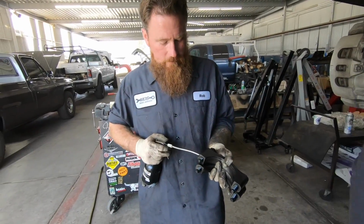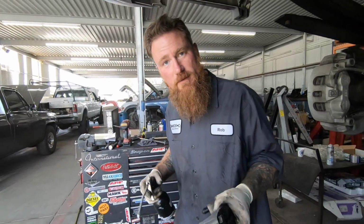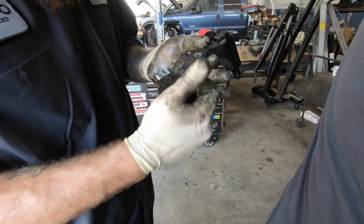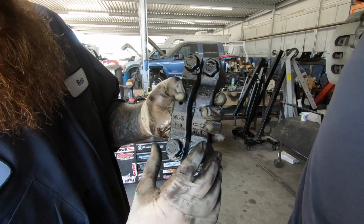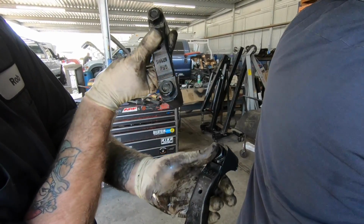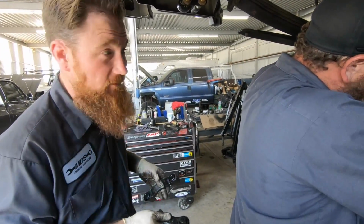On your cap bolts, you just want to oil the threads and oil the flange on the bolt. You don't want to use Loctite because it's going to affect your torque value and you won't get the correct torque. Wow, I had no idea. Also, that's good to know. Before you remove the caps, you need to mark them. I use a stamp with right and left, and I stamp them both on the bottom because the way the case is cut, if you mix them up and put them in the wrong place, it's not correct. It might not hurt you, or it might cost you a lot of money.